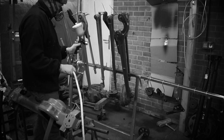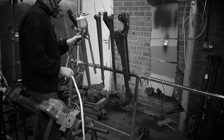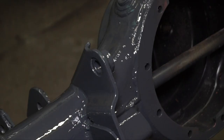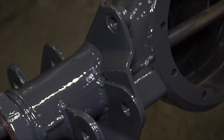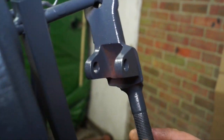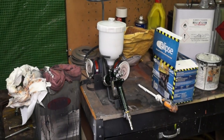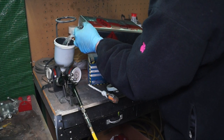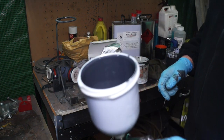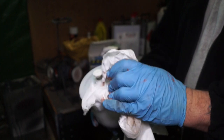I'll show you the end results of the spray session. The chassis paint went on very thick, doesn't need any more coats, there are no runs, and it's filled everywhere needed — although I did miss a small patch. Just a reminder: any spray gun needs to be cleaned out after a painting session — never let the paint set in a gun. Using standard thinners, clean the insides to get rid of all the paint, then clean the outside as well so the gun is ready to use next time.